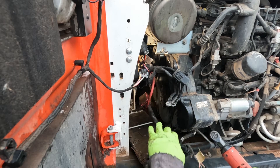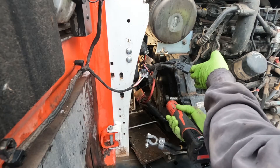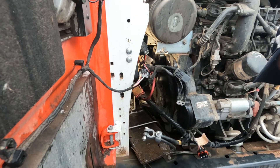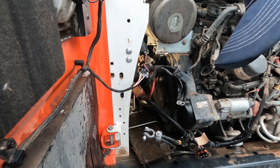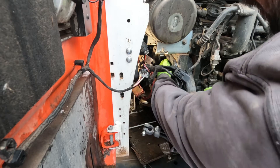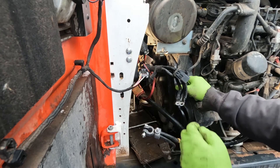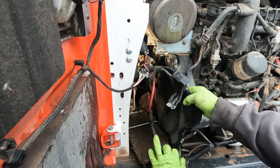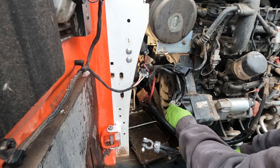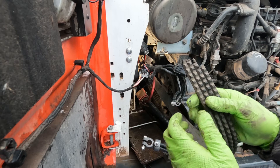Now that I've got the battery out of the way, we've got the drive belt cover — just one half-inch bolt with a half-inch head. I get that bolt off and I want to pull this cover toward me a little bit, because it's on slotted screws and sometimes it's very difficult to get that cover to slide towards you. We might have to loosen the retaining screws themselves to get this cover out of there — not always, but sometimes. And there's what our drive belt cover looks like — now we've got access to our drive belt, and yeah, she's broke.